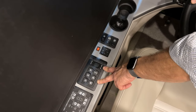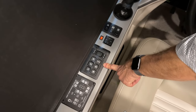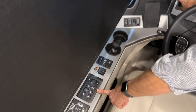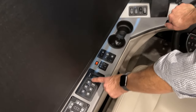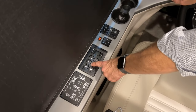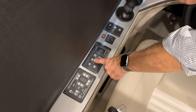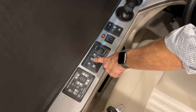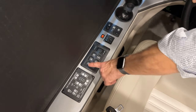Release the parking brake by pushing it in, then select drive or reverse — the center position is neutral. Leave the coach in neutral when parked, then pull out on the parking brake. Whenever you come to a stop, put it in neutral and pull the parking brake. D is drive.